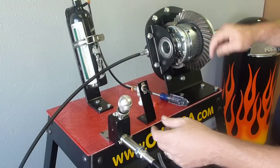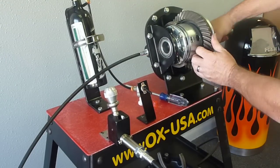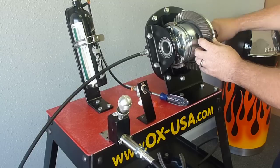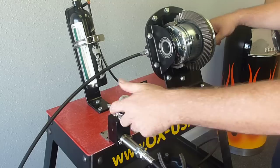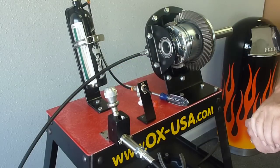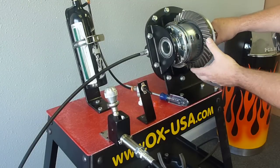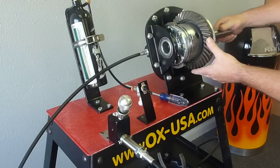This should be a pretty good adjustment. As we shift it, we go into lock. As you can see, the axle's not going to spin in full lock. Unlock — now we've got the ability to have the open differential. What the spring is doing in there — what you're trying to get adjusted is, depending on the position of the gears inside this locker, when you go to shift it, the locking ring didn't move over. But it's ready as soon as you get enough differentiation. As soon as the axles turn — as you can see, I just barely moved it — it goes into lock, and now your axle's just like a spool. Unlock, and you're open.